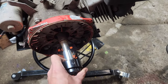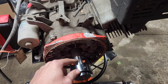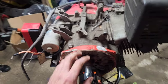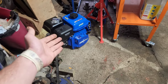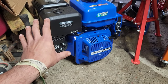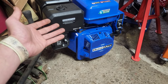As you can see, the back side of this, there's the generator tapered shaft. Eventually we're going to see if we can do a conversion. There's a lot of different ways you can potentially convert these. We're ripping the entire engine down, pulling the crank, and we're going to see if we can manage to weld the sleeve on and cut a keyway.